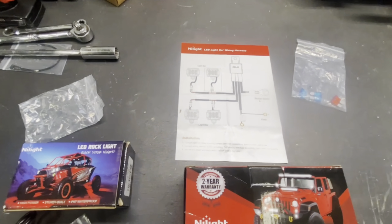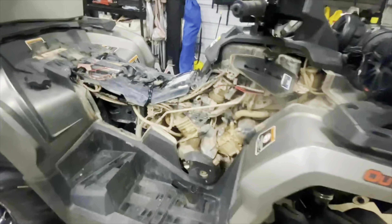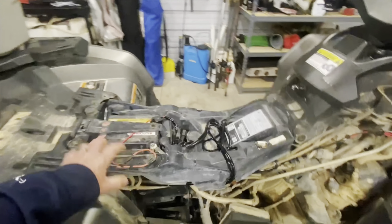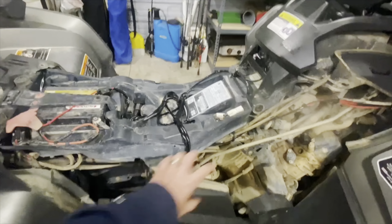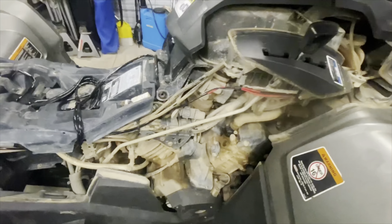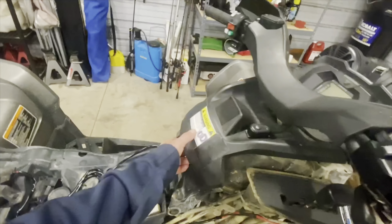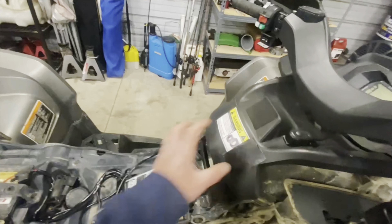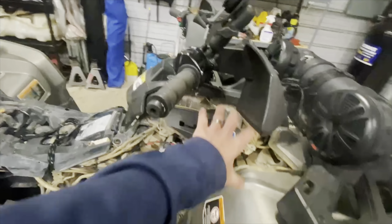Now I'll go over to the machine and show you where I put the wiring. First thing you'll want to do is take off your plastic, which is pretty easy. Remove your seat, then take off the two pieces - the small piece and the bigger piece. They pop off pretty easy with a couple push pins under the fenders. Then your cover pops right off, and this section just lifts up and comes off. Your top part you just take off, and that's where your harness is for your dash - just lay it up there so you've got everything exposed.